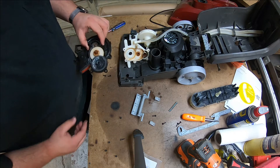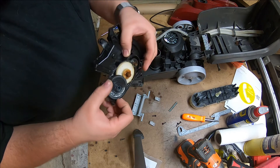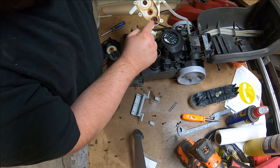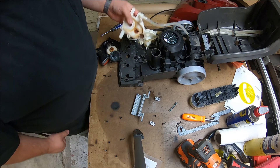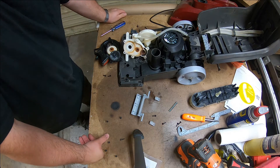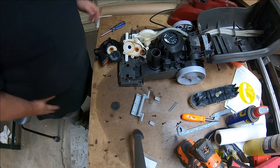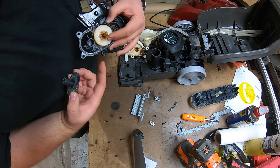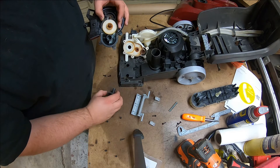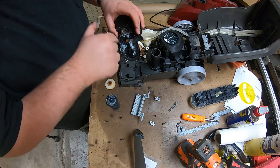You can see all that corrosion — and I was in here less than a year ago. All that gunk and corrosion on a bearing that's less than two years old, completely jammed in position. This is why I say the design is genius but very poorly executed. I put white lithium grease on this thing to help reduce some of this, but as you can see, that didn't work.